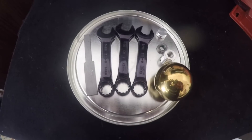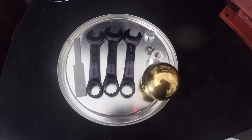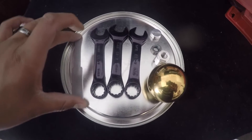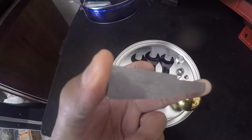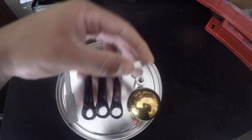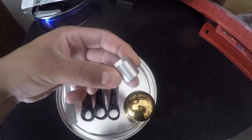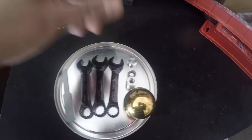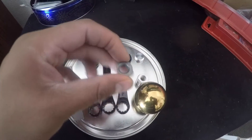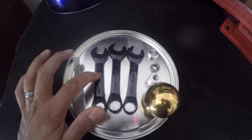The tools you're going to need to install your solid gold shifter knob — other than what TWM Performance supplies, which is essentially a two-sided tool, one for the spacer that's going to go inside of your shifter knob, and the part that's actually going to thread into your factory threading where your shifter knob goes. And this is your jam nut that's going to go on first. You're also going to need a 14 millimeter wrench.